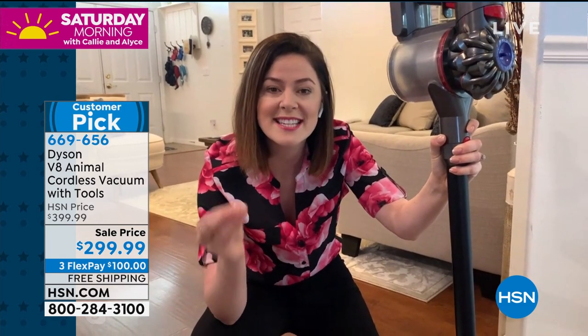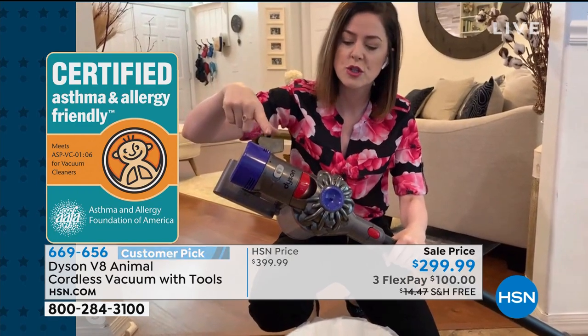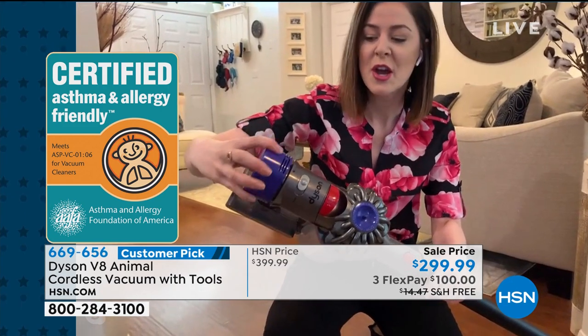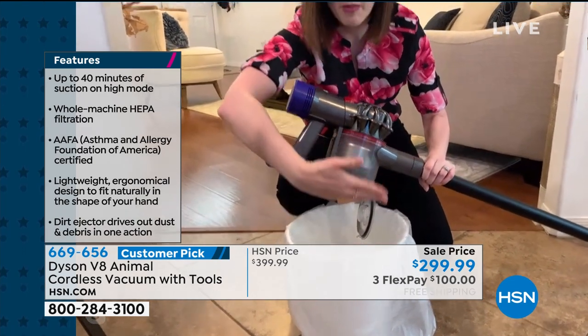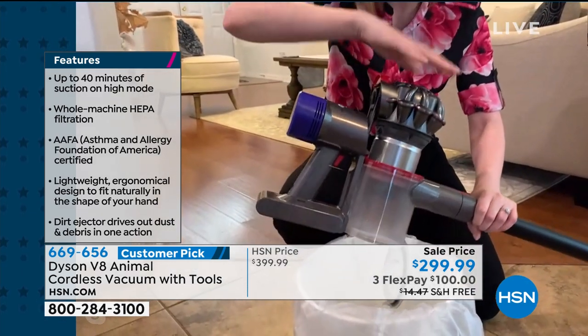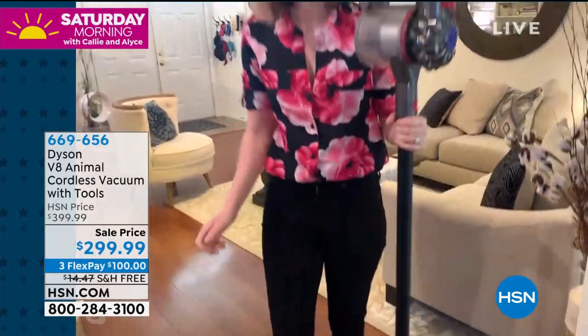All that stuff you suck up — the pet dander, pollen, skin cells, dust — stays trapped inside because of the ASTM filtration certification: 99.97% at 0.3 microns, meaning everything stays trapped and doesn't get released out the back. You have two filters, one here and one here — they're lifetime filters, not something you replace. Just rinse them once a month under cold water, let them dry, and pop them back. To empty, red means action — pull it up, out comes the real-world dirt. It has a silicone collar that cleans it on the way down, so you don't have to put your hand in.